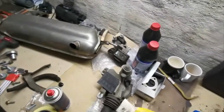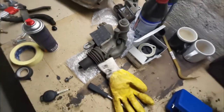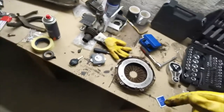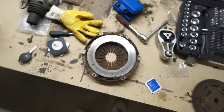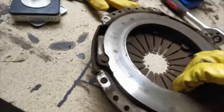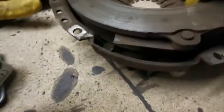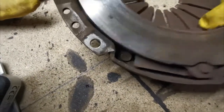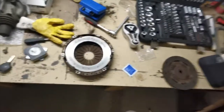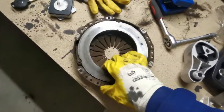The motor mount had to come off, throttle valve had to come off. Then we're going to install this bottom motor mount and reinstall the clutch actuator. There was a rattling noise from the gearbox and the Smart dealership actually recommended replacing this clutch. And here's the guilty party — I really don't think this is supposed to do that. You can see it's actually snapped here. So the clutch engagement was actually clunky, really harsh from first, and also noisy. Guess we know why.